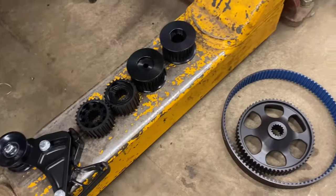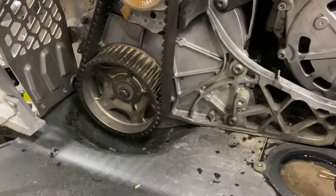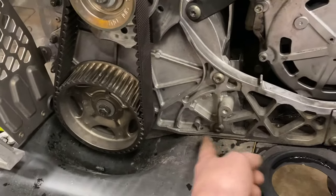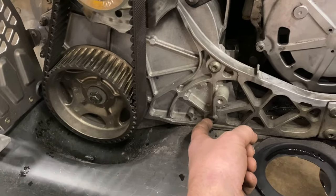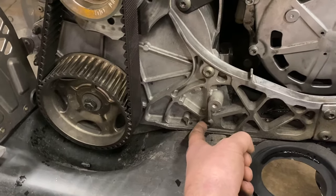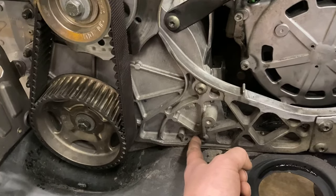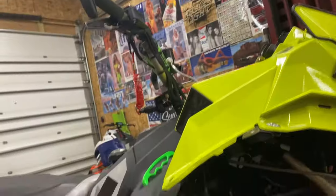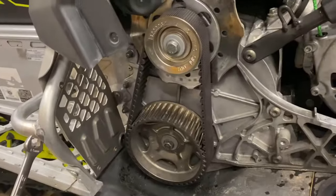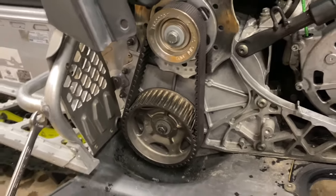It's pretty easy to put in. Basically, the biggest thing that I've collected from reading online on how to do it is these bolts, these T40s or whatever. You need to heat these up like you're working on a helix and a clutch. There's a glue inside of them, kind of a Loctite from Polaris, so you've got to get it out. And then with these guys, you want to make sure you set your brake before you start this because you don't want anything to roll around. Slip those off. I've had them off in the past and it's been kind of a headache, but hopefully this goes smoothly.